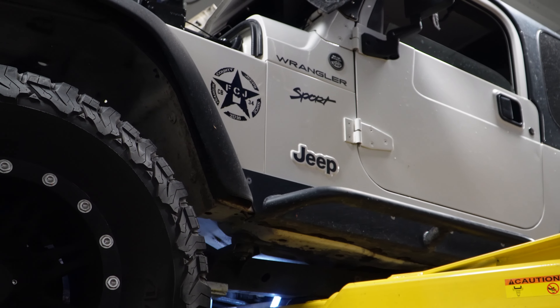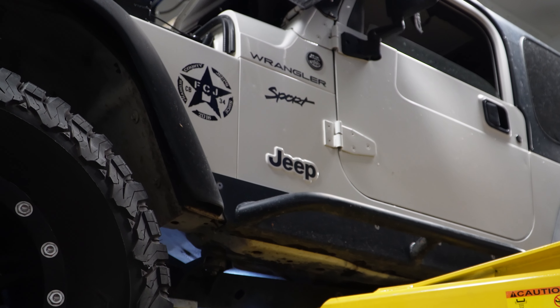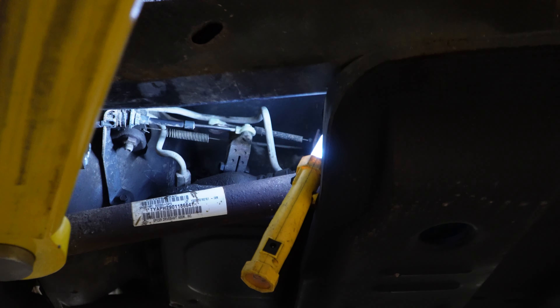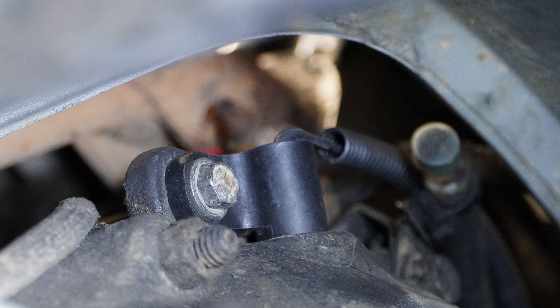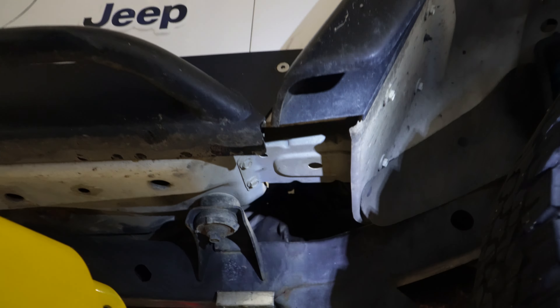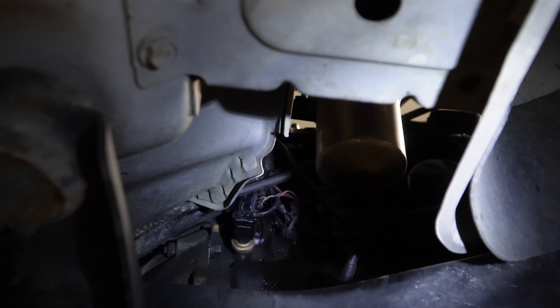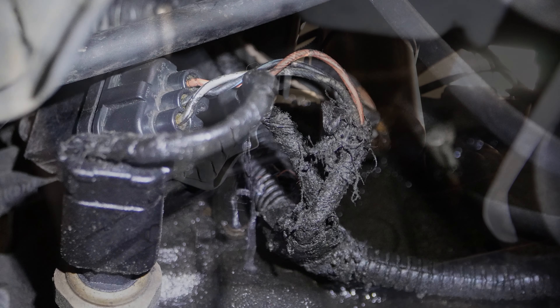The sensor is located on the driver's side of the bell housing, so once you have the vehicle up in the air, just go underneath and right up through there — you can see the sensor just on the driver's side of the bell housing with the bolt. The connector is on the passenger side right behind the front wheel. If you go in and look above the frame you can see the connector right there — it's a three-wire connector just above the oil pressure sensor.